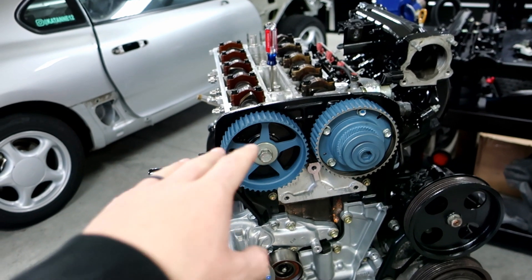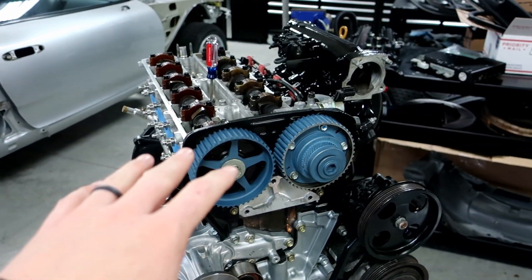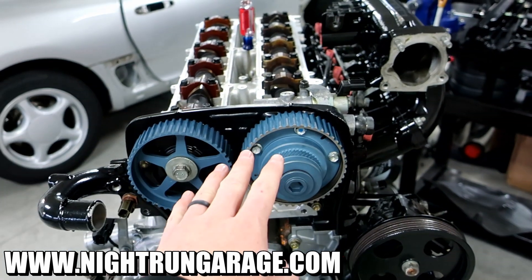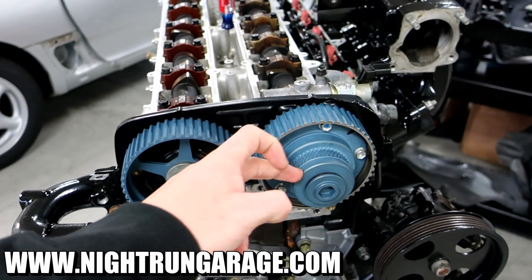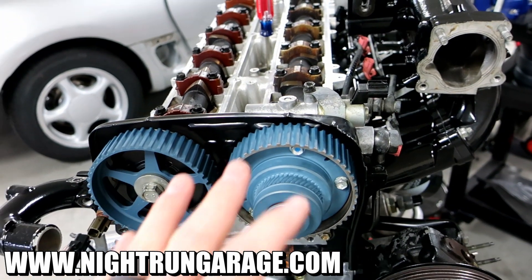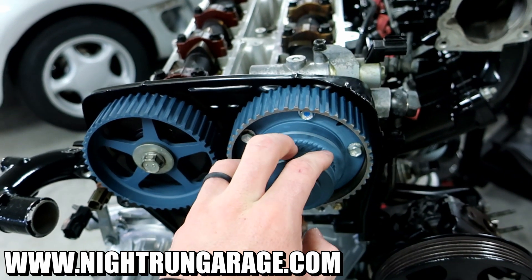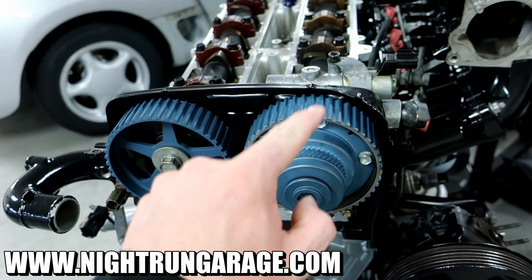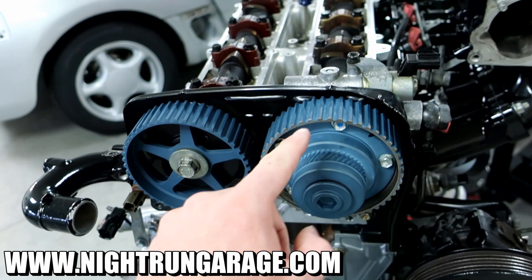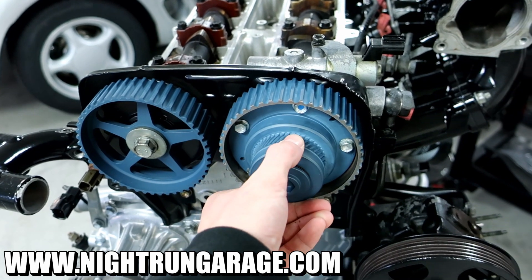Before I get into today's video, I want to thank the guys over at Night Run Garage. They went ahead and Cerakoted and rebuilt the VVTI gear on my 2JZ engine. If you have a non-VVTI you won't have this, but if you have a VVTI 2JZ or a 1JZ you'll have this gear and it does need rebuilding. Unlike most people realize, this actually has oil that goes through it that can actually move it. This gear actually does move and it has to do with the solenoid. There are seals inside that you're supposed to get through Toyota but you can't — you have to buy a whole new gear. Ones from eBay don't fit. Night Run Garage sourced their own Viton seals that you can buy directly from their site, or you can send this gear to them and they'll rebuild it and do this sweet Cerakote on it.